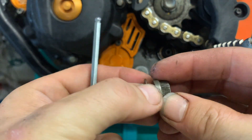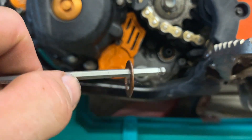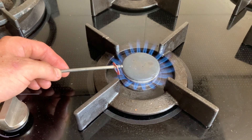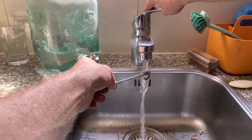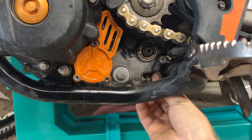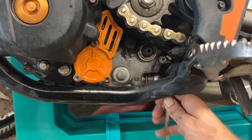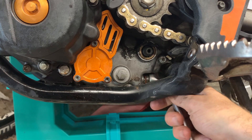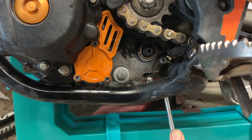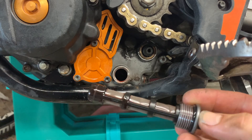So here we have the oil drain — this is a copper ring. I'm gonna heat the copper ring and then cool it off and then I can reuse it again. After heat treating you can use it again. I have to clean it a little bit — all right, that one is clean.